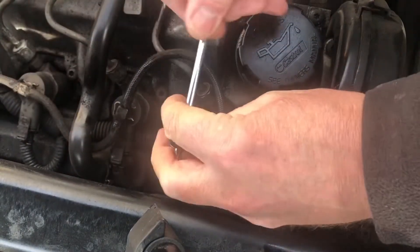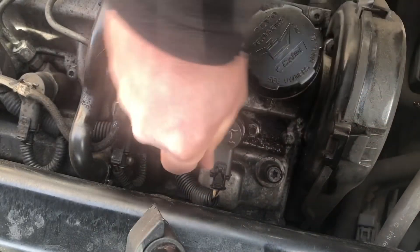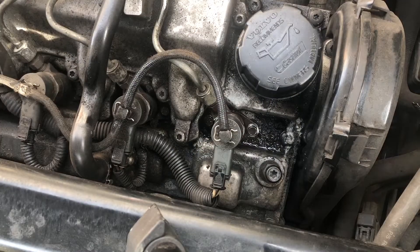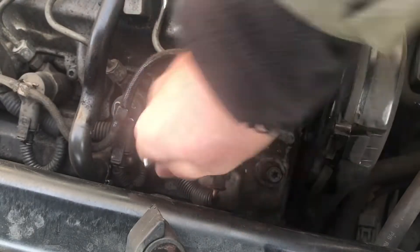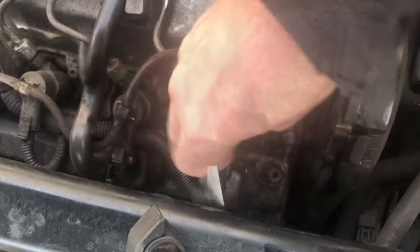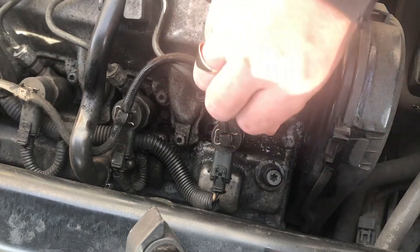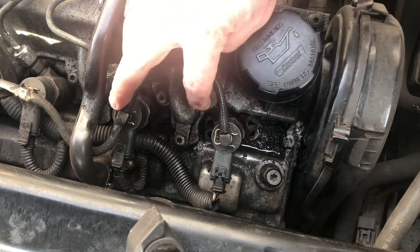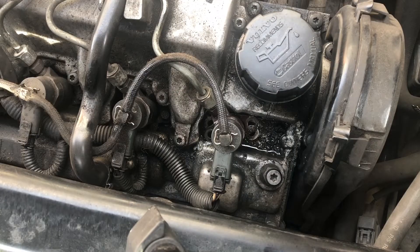That cracked — it just went. We'll remove the bolts for now; it doesn't feel very good at all. I'm just going to work some penetrating fluid back and forth into that — I don't want to damage the threads, so it's quite literally three steps forward, two steps back. You can feel it's getting easier. I'll get the ratchet on this to speed it up. Both bolts removed, the clamp is quite loose which is exactly what we want. I can actually just see a lump there, so we're going to remove this nut from the injector.